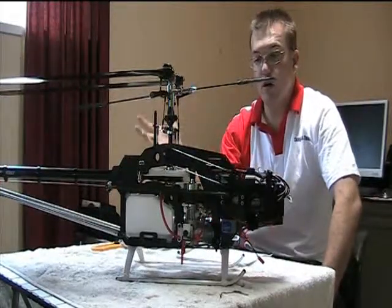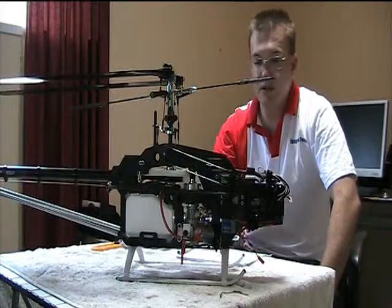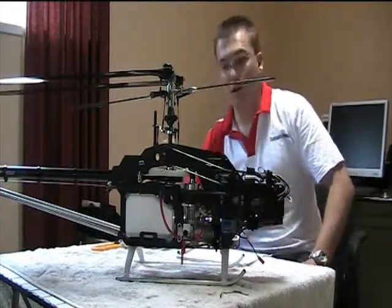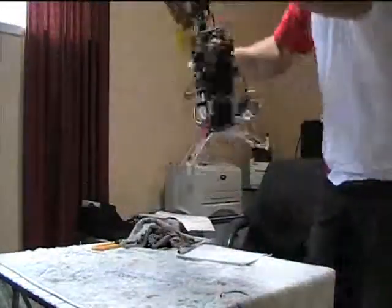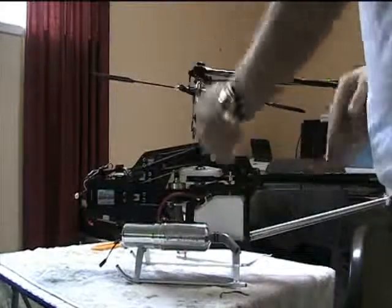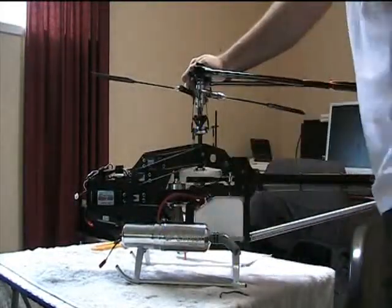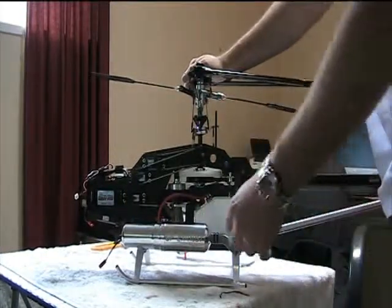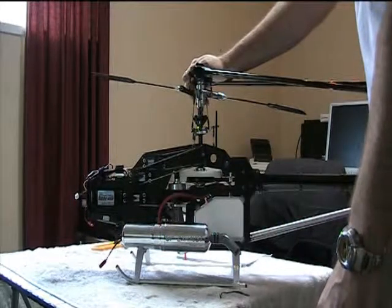So that all goes along with the engine, fan, clutch and pipe installation. Pipe installation is very, very simple. It's just 2 bolts through the side, and I've gone with the GP Exhaust Energy 57 muffler, which is the new muffler design for the high displacement engines of today: the YS56, the NR57, and the OS55, and the OS55 is obviously what I'm running. So there it is. It's all mounted and ready to go, and I actually maiden hovered this bird last night, and everything was running sweetly.